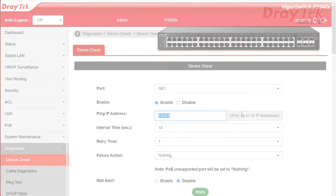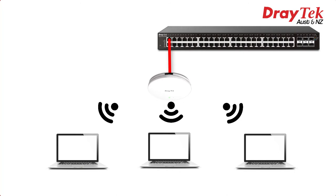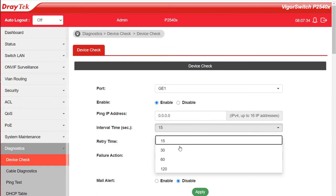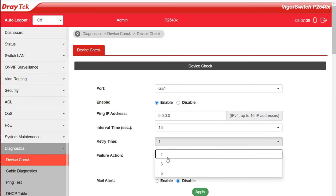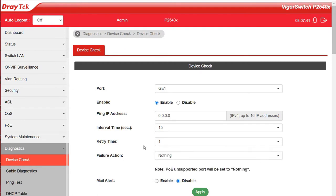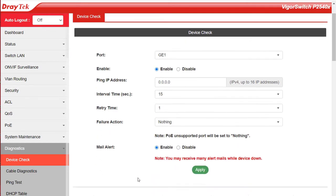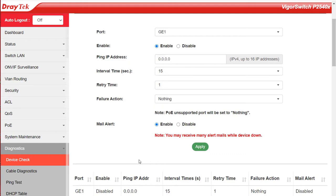For example, if you have an AP connected to a port and enter the wireless client device IP addresses, assuming they don't roam to other access points, you can check that the wireless broadcast of the AP is still working, rather than just checking that the AP is responding to a ping. Down here we tell it how often to ping — from 15 up to 120 seconds — and how many times to retry from 1 to 5 before taking action. Actions include Power Cycle, which cuts power to that port then restarts it, forcing the PoE device to reboot; or it can shut down, or do nothing. We can also set an email alert so someone gets a heads up if it ever happens.